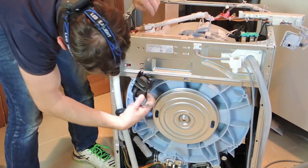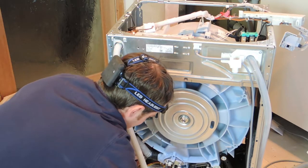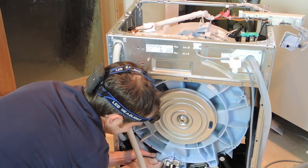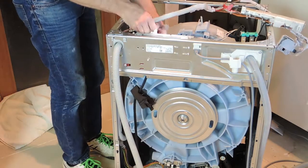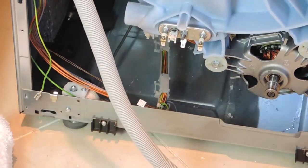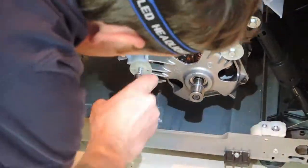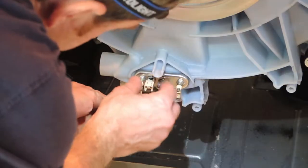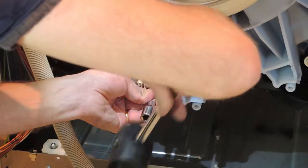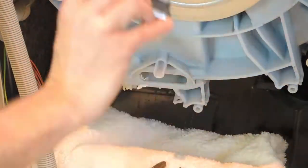The electronics assembly just needs unclipping — hang that on the back of the machine or over the top. There are some more wires to release which feed into the motor. The motor itself needs to be removed — just a couple of bolts. It slides right off the back; quite heavy, so be careful. Now to remove the heating element: just unscrew that nut almost all the way, bang it in, and that should give you space to remove the element itself, which as you can see has quite a bit of limescale.